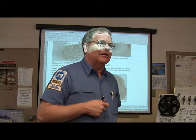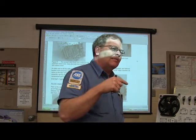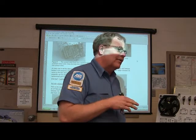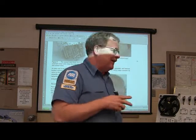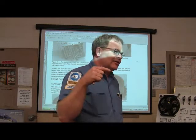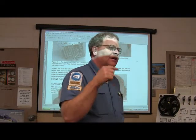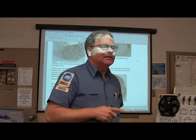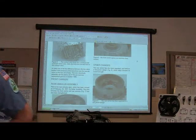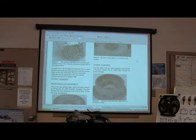What has happened there is you've actually heated that bolt up that you're trying to drill out to the point you've tempered it, and now it's really hard to cut it with anything. You always use liquid. If you drill it not so fast, if you can slow your drill down and use some kind of penetrating oil or whatever to lubricate it, then you're better off that way. All right. Now then, let's come on down here.